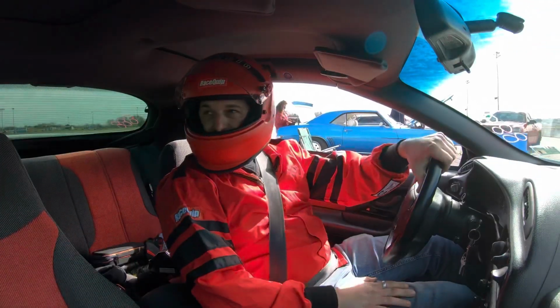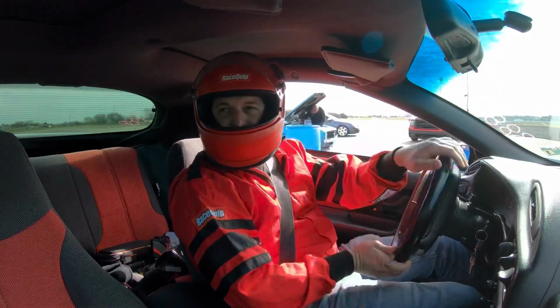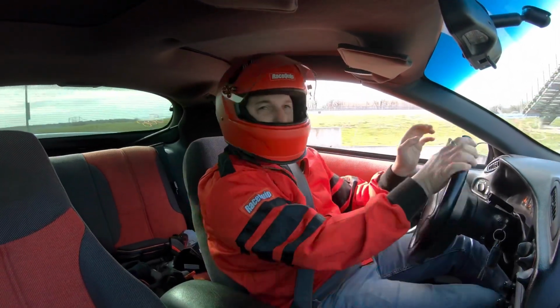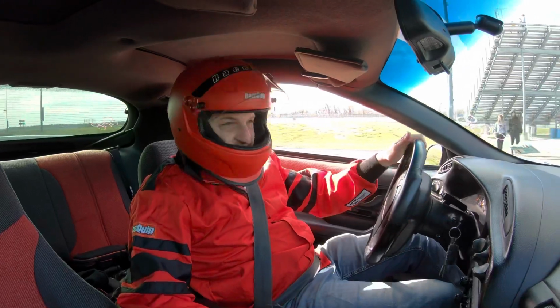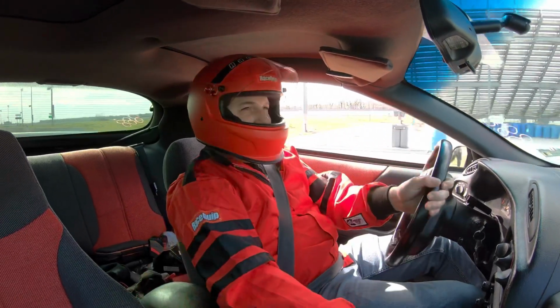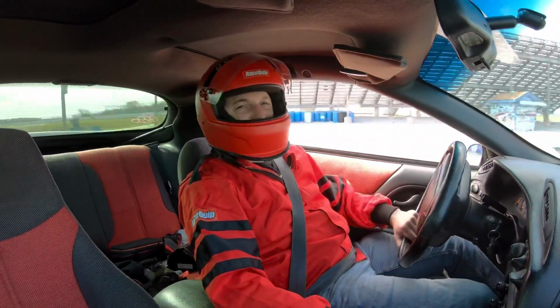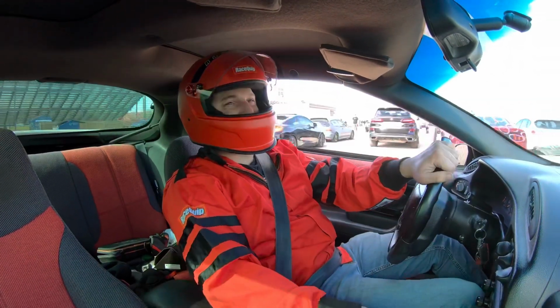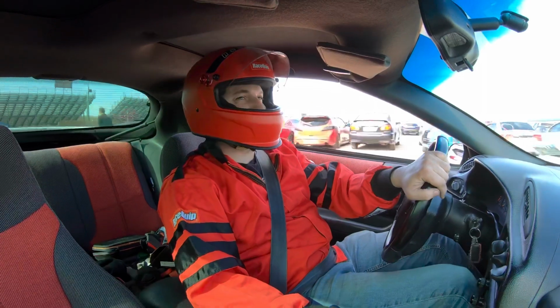Yeah, I ran a 12.5 at 112, 1.860 foot. I looked at the data log. It's rich as hell. I think I don't have enough bottle pressure. It's always something with me, I swear. I knew when I was purging it, they didn't have enough nitrous in it, so it's barely got any nitrous in it. So I think it's just full of air.